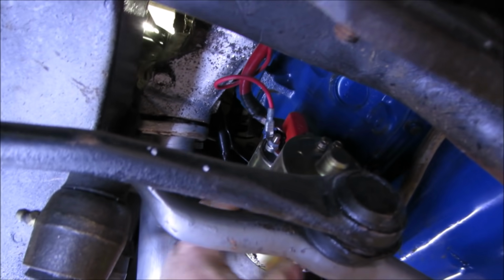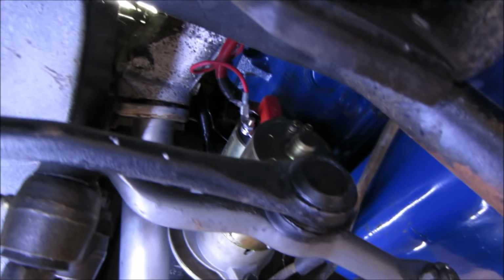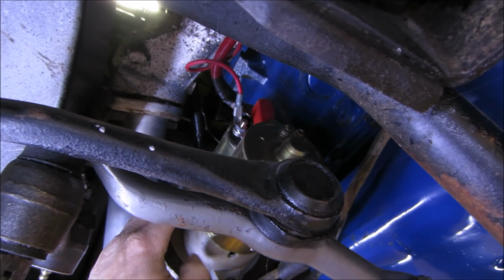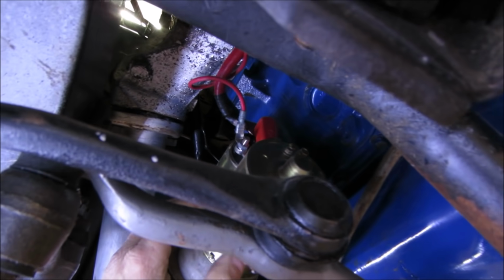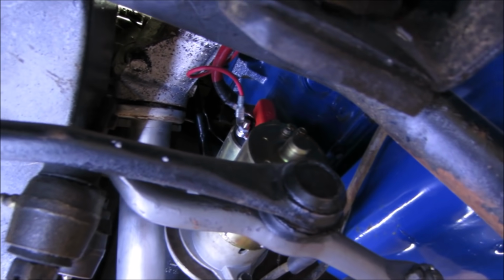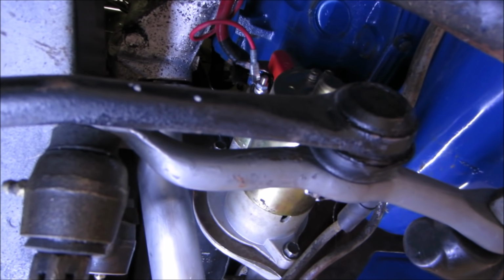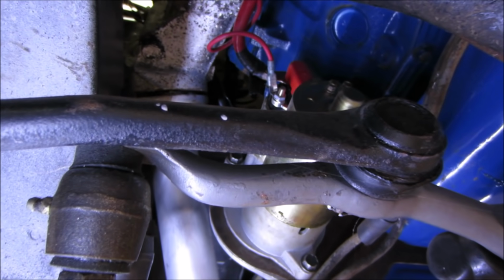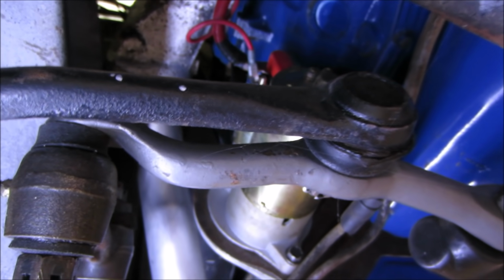So I looked underneath, it has another solenoid. So it's not what the factory setup would be. They have a weird kind of combination going in. This wire has to get power for it to crank the starter. So we may still have a problem with that starter relay up top not doing what it's supposed to, or just not wired correctly. Let's go look back into there. We'll see if we get a signal from the key to fire that solenoid up top and chase that a little bit.